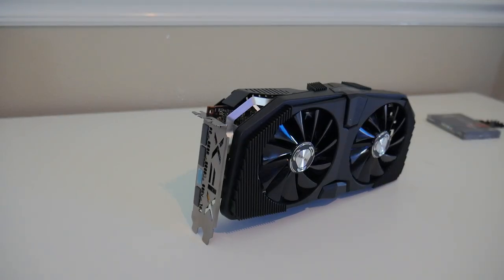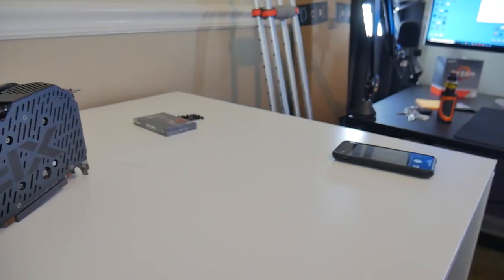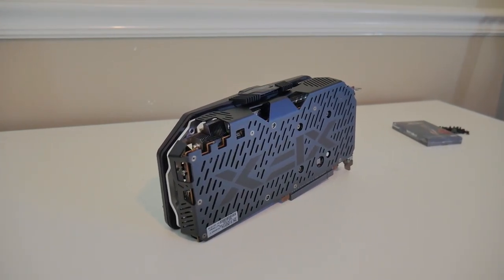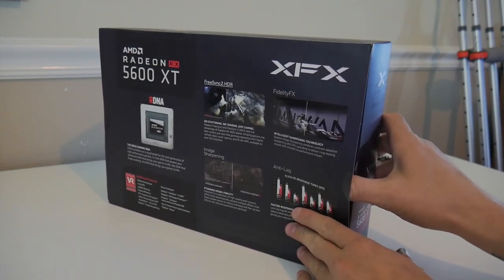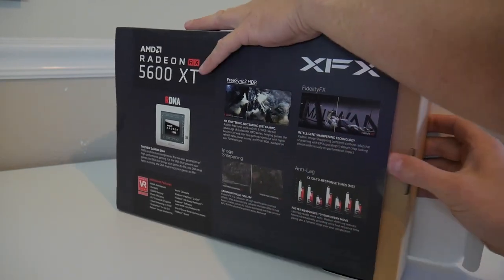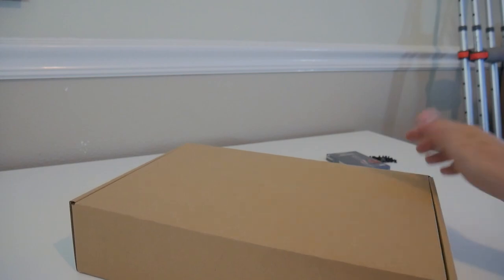You also want to keep in mind right now, 4 gigabyte cards are going to be out of mining Ethereum by the end of the year. December 2020 is the estimated date that the DAG will reach above 4 gigabytes. So start dumping those 4 gigabyte cards and start getting at least 6 gigabyte cards. 8 gigabyte cards are preferred, of course. The 5600 is not going to have that. However, the 5700 XT, which is a little bit more expensive, does have that option. We'll go over mining performance on the 5700 XT as well, but just keep in mind that that's where we're sitting at.